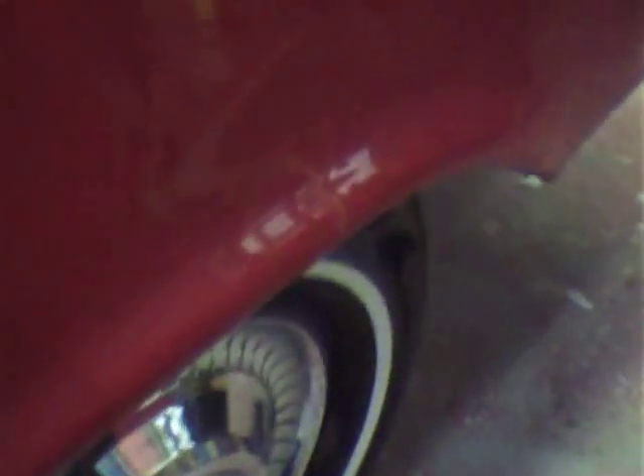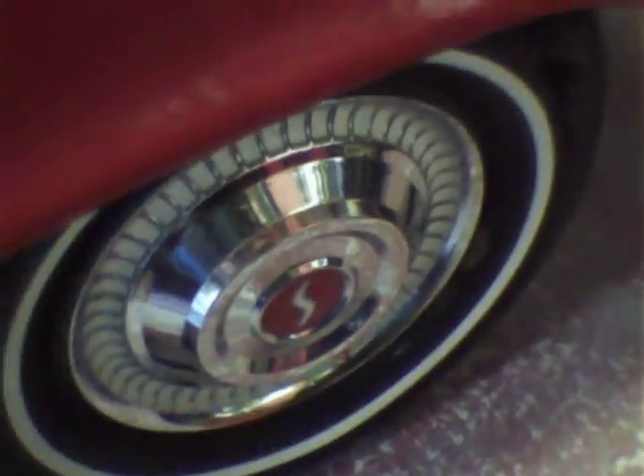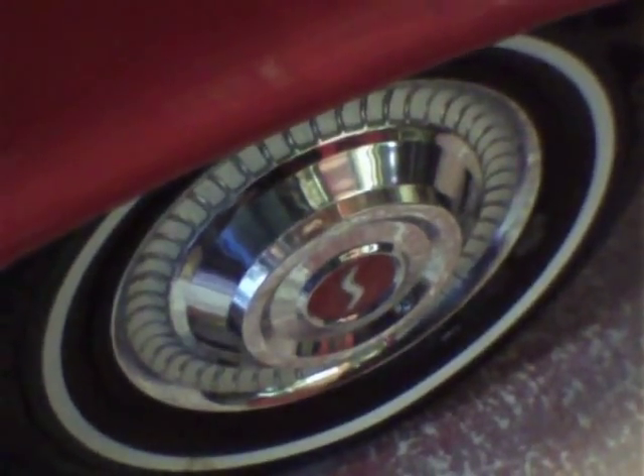In the back is a Mustang 8.8-inch rear end. It's been converted over to five bolts in a standard Ford/Mopar bolt pattern. The rear end ratio is 3.73s and it has a positive traction setup. So with the low first gear in the 700R4 — which is 3-to-1 — combined with that rear end ratio, it really comes out of the hole hard, which is lots of fun.